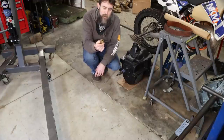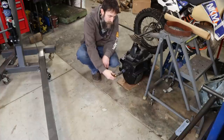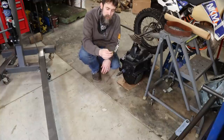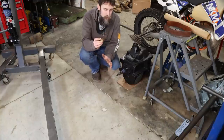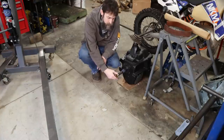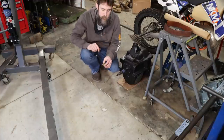I pulled this pilot bushing out because it's good, not because it's bad. I'm replacing the motor in my truck, and my replacement motor doesn't currently have a pilot bushing in it. Using that bread, it gets these out with no joke, without putting a scratch on them. Just checking the fit here to make sure it's still good — I know it is, it's got very few miles on it. So now we can reuse this bushing, save a few bucks, maybe teach a guy a new trick.